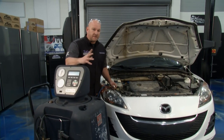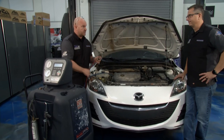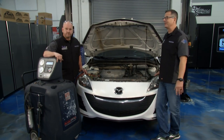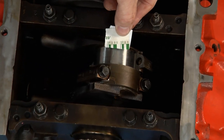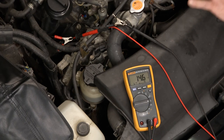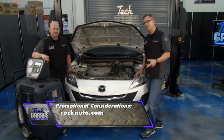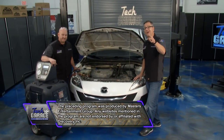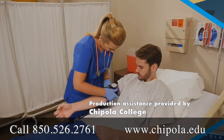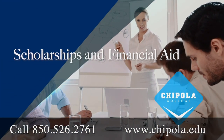The new compressor is in, everything's buttoned back up, and that new stretch belt is on. Final step: evacuate the system for at least 30 minutes to get all that moisture out, then recharge it, do a performance test, and this thing will be better than new. It's all about technology — the LS build, the Plasti Gauge precision, and Garage Ed covering the computer system and how it all interacts. We're out of time for today — keep the social media coming. We'll be back next week with more Tech Garage brought to you by rockauto.com.